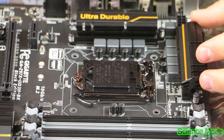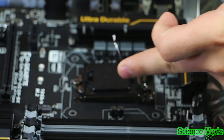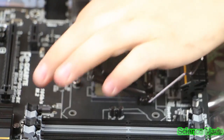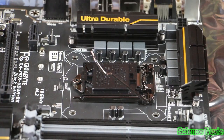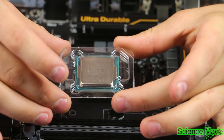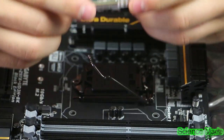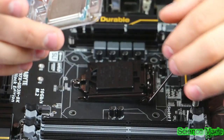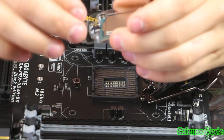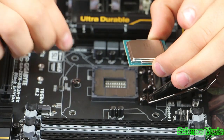Installing a CPU is fairly simple. You have this little lever that comes down and out. That lever comes up, then you flip up the cover piece and see your CPU slot. Here's our CPU — the most important thing is you never ever want to touch the bottom of a CPU. The bottom is very important. The CPU has a notch in it which makes it really easy to install. You'll also see an arrow in the bottom right corner to show you where to go.